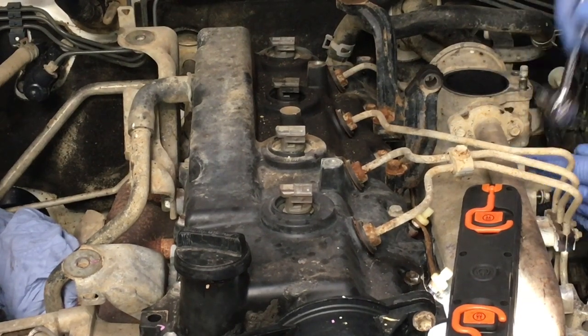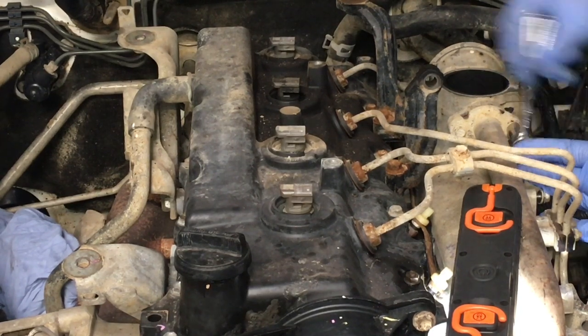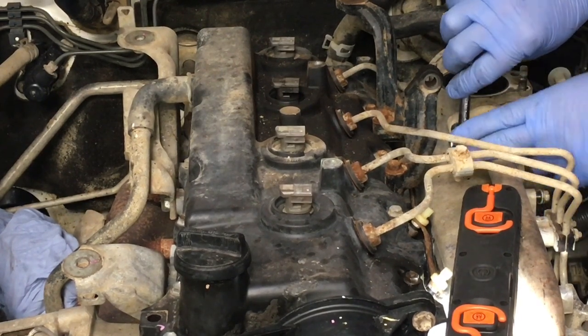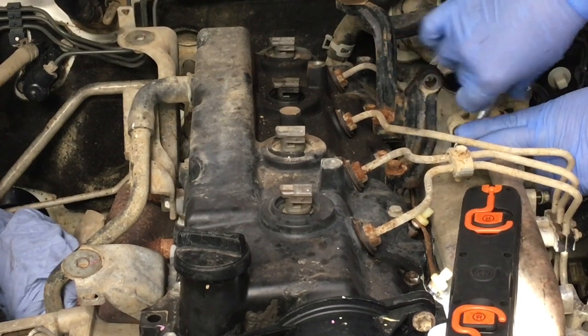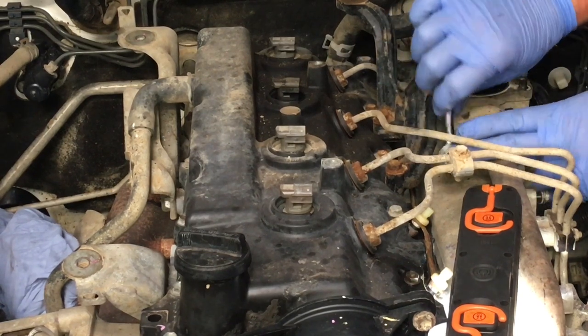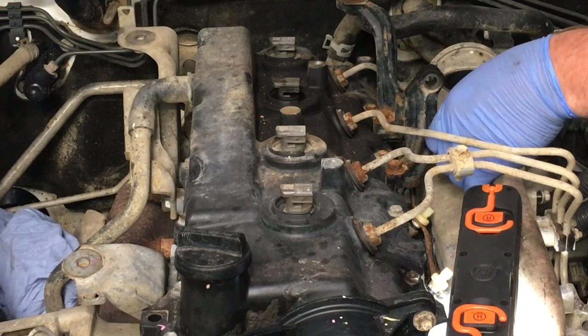So what that says to me, although it'd be nice to put a plate in there, in my opinion, it's not worth the risk of creating more work, busting things that could cost many hundreds of dollars in labor to R&R other components and fix that up. Worst case scenario, you can't get it out of the head and you've got to get the head off to work on it, ending up costing him thousands.